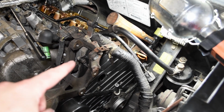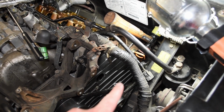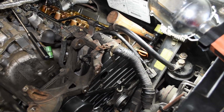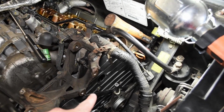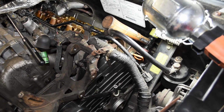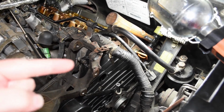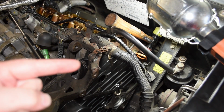After that, I started this bolt. And then these bolts here on the face were very difficult. The one in the very front top corner is nigh impossible to get to. And with the new gasket swell pushing this up, it was impossible to start that without doing some things first. So what ended up working, though, was first, install loosely this bolt.